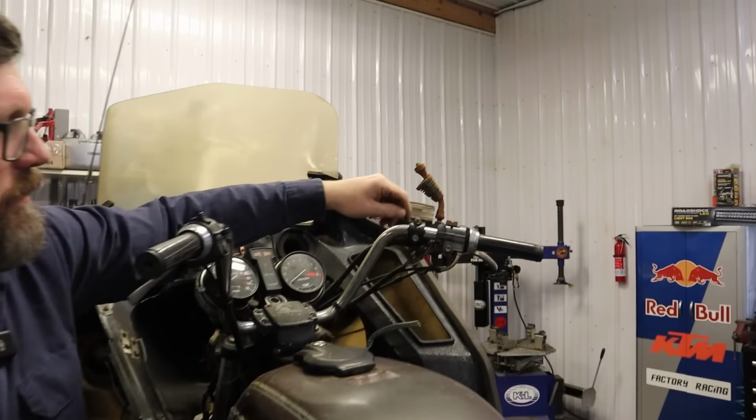So what's really cool about this motorcycle and why it changed Honda as a company forever is because of the engine. This is the first V-twin that Honda ever produced. This is an 80 degree V-twin, and it was kind of modeled after the Moto Guzzis. Honda just couldn't leave well enough alone with the engineering. So of course they took it to the next level. This bike is water cooled, and the transmission is actually mounted here underneath the crankshaft instead of a unit behind the engine. Now this is a 5-speed transmission, but one of the really cool things about it is it spins opposite of the engine, and that's to help counteract the torque that the engine produces.